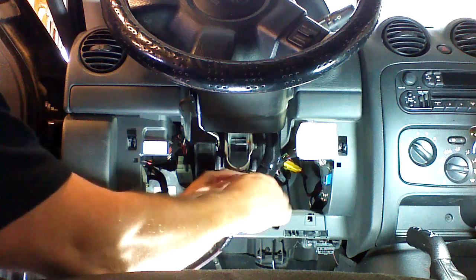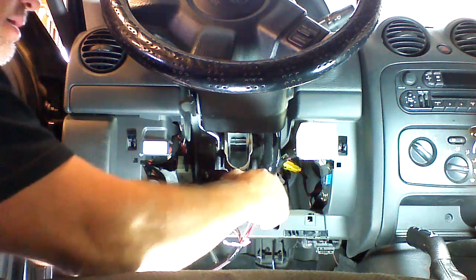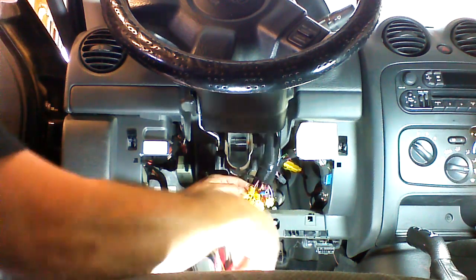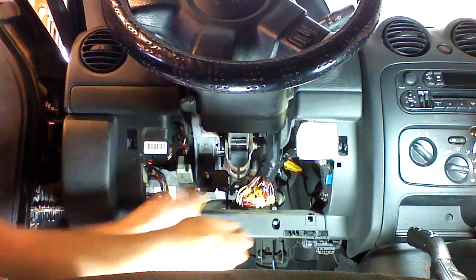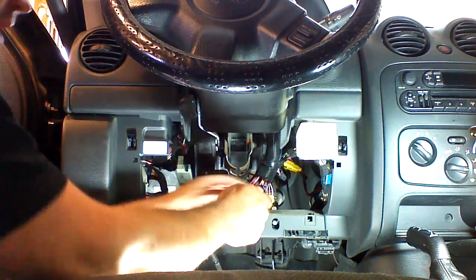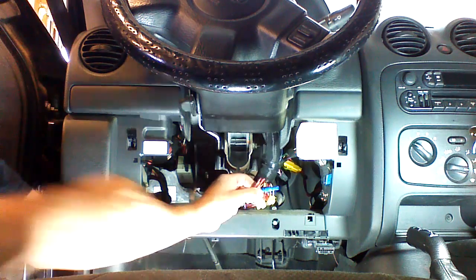So I'm just going to go ahead and remove everything and just show you how easy that is. Just loosen the collar, pull the wires out, and we can unscrew the Posi tap, take it off, and it leaves no damage to the wires. Little teeny pinprick right there, that's about it. So we're going to take all of these taps off and we're going to continue with the job.